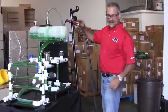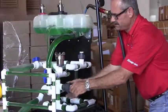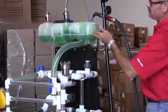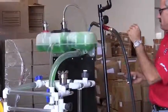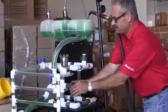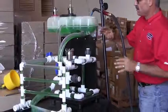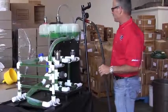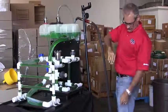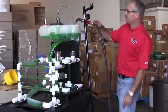This is going to put it under vacuum. This time when I pull this component off, it's below the water level, so the tool is going to have to hold the coolant in. What you can see happening is the air entering the cooling system here is bringing the water up in the surge tank, and some of it is actually going through the tool. Now we're going to change this component. There's not a lot of air flow anymore — the tool is putting the cooling system under vacuum, right now at about 10 inches of vacuum. When I turn it off, that vacuum is up here and in all the other locations, putting a suction on the hose that goes down into the bucket, pulling the coolant up out of it. You'll see the water come up through here, through the tool, and through this.